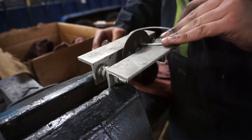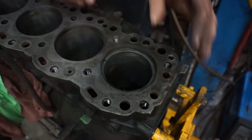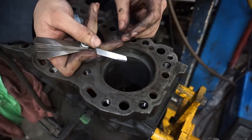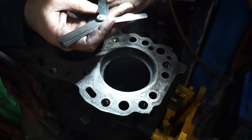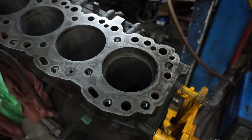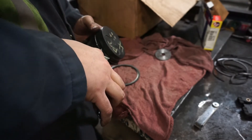If the gap's too tight, you can make yourself a little jig and grind down only one side — and if you do this, only grind one side, then recheck it. This is the second ring on the piston; the first one you saw earlier was the first ring. Go through both the first and second ring — don't assume because the first one's fine the second one will be the same. I checked every single ring in the package. It's time-consuming but trust me, if you're building an engine, just take your time and go through every little thing.